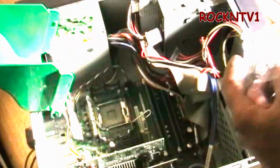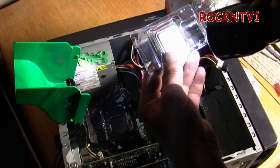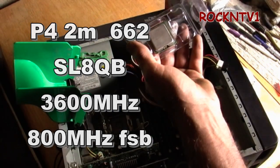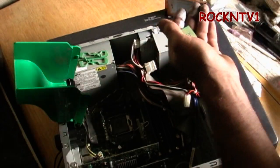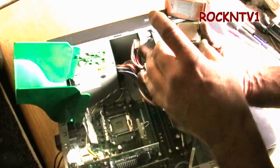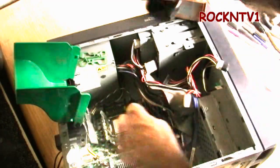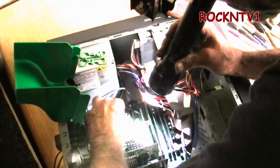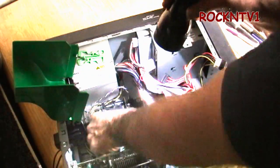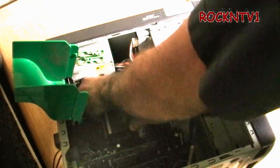Here's my other CPU — the marking looks like SLBQB, Costa Rica, a 662 machine chip. I take that and go like this, stick the old one back in that slot so I don't smash it. Don't touch the chip, especially with greasy fingers. This is something I'm selling so you're not going to see me taking full care of the machine — I'm showing you how to do this. Flip your lever, then put the new chip on here like this, click.